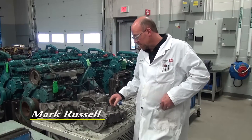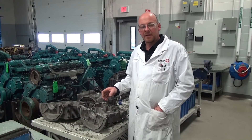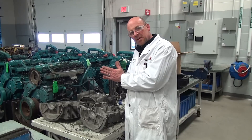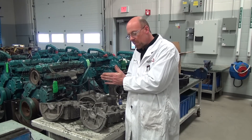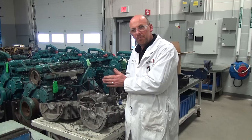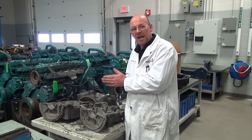We're taking a look at the VW type engine case right now for inspecting and checking the lubrication system function. The case itself is a two-piece case where both halves of the engine are connected together, so it's really important during the time of the rebuild or the overhaul to make sure that the pressure regulating and pressure relief valve circuits are checked and inspected.